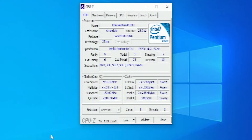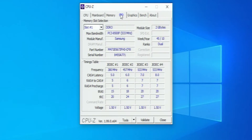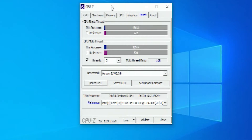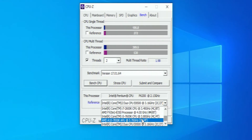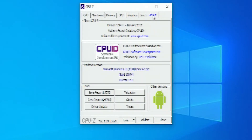Here we're taking a look at CPU-Z on our dual-core Pentium P6200 — socket 989, 2.13 gigahertz, 2-core 2-thread — on an Intel motherboard with PCIe 1.0 and 4GB DDR3 RAM. It's got built-in chip graphics. We benched the dual-core CPU by itself, then referenced it against a desktop Core 2 Duo E8500, and threw in an older AMD CPU — two-core four-thread. As we can see, our processor is fairly weak.